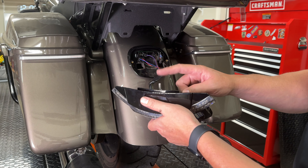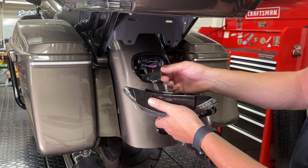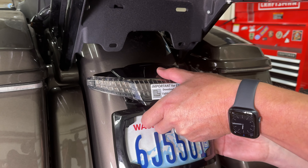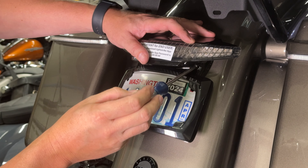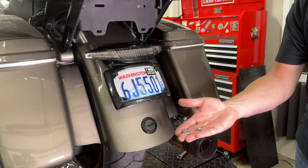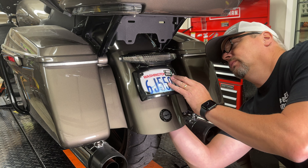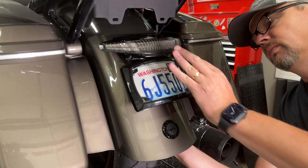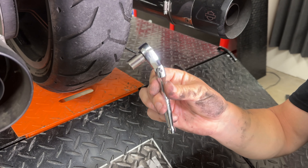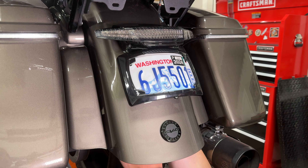Note there's a stud we're going to have to line up in a minute — it goes through a hole there. There's also a big brick that you'll see him fit behind it. Everything will fit up in there. He's lining up that stud and getting it through the hole. The kit comes with two Phillips head screws, one on each side. The last thing is the big stud going to the inside of the fender — the kit comes with a washer that goes first, then a lock nut. The only way to do this is just reach up in there. Lurch made that look easy. He's decided a ratchet and socket — 7/16ths — is probably the easiest way to get up in there and finish tightening that nut.